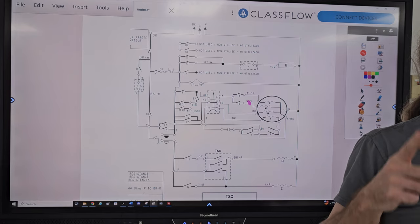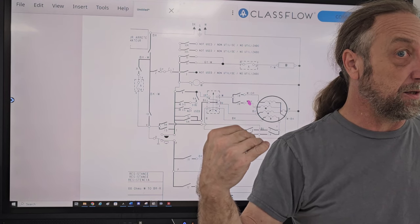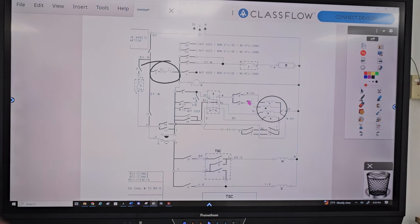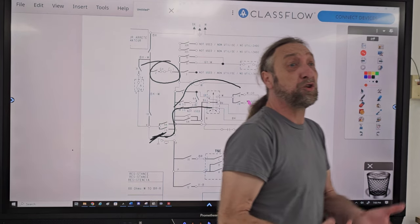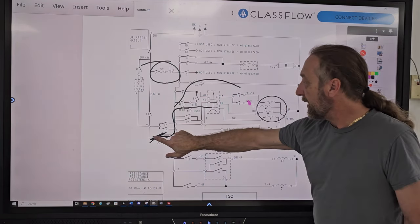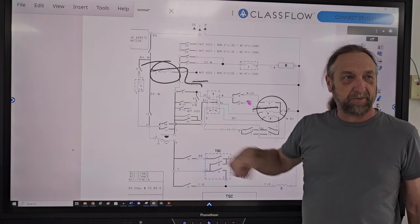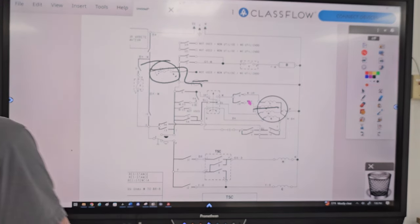Okay, but that's not the timer motor, because even if the timer motor was dead, the drive motor would still run and spin. I said it started draining and it stopped before it completely drained and the timer didn't advance. So the bypass on this one would be the bypass or the lid switch, because what happens when we first go into the drain, the machine is full of water. So the motor and the timer are going to run when it first goes into the spin cycle. But as it starts spinning, the water is going low, we have less pressure on the switch. This switch opens up, and now the only way the timer and the motor can operate is if power goes around that switch. So if these two switches don't operate, that's what's going to happen. So you see why I'm pointing out the bypass and the type of problem that may happen.